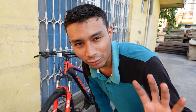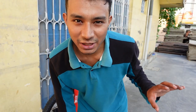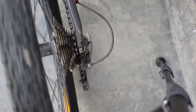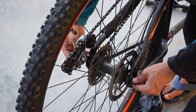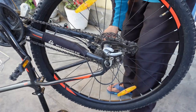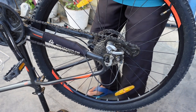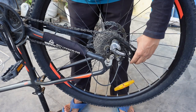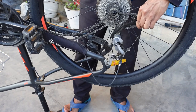Now we will change the rear disc brake pad. The back tire is a challenge — you can't simply remove the rear tire. First, shift the gears to left side gear 1 and right side gear 9 or 7, so the chain comes to the smallest sprocket wheel. You will need to move the cycle, then open the quick release. My back tire was quite tight, so to remove it, you move the derailleur arm, shift the chain, and work the tire out carefully.